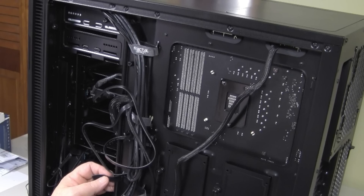The last thing I did was connect up the system fans. There are five system fan headers you can connect on this motherboard — I had three to connect and they were super simple. The case itself also has its own fan control switch on the front, but I decided not to use that because the Gigabyte board has software that manages the fans based on temperatures, so that's the better way to go.